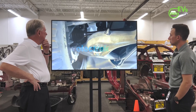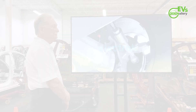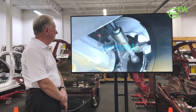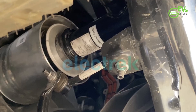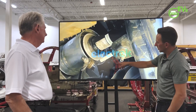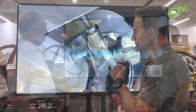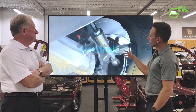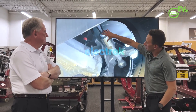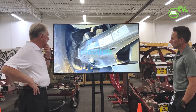It has some components that aren't off-the-shelf parts — some machined bits in the front suspension appear to have been made using a lathe. It also looks like there's a bolt missing along the high-voltage cable channel, and the cables themselves aren't protected with a rugged cover. Overall, the two experts say everything looks pretty conventional with nothing groundbreaking in the suspension setup. However, at one point in the video, clues about Tesla's Gigacasting techniques are visible, which is something no other automaker uses at the moment.